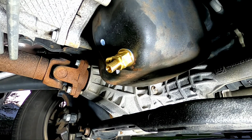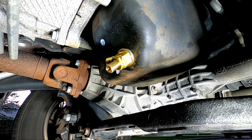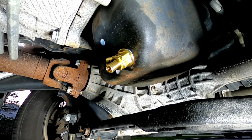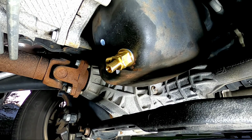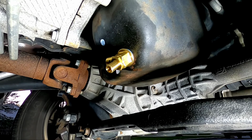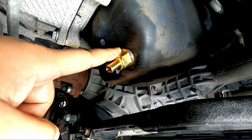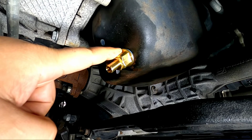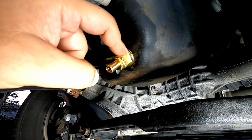Now, the best way to do it is what? Using a torque wrench. So any do-it-yourselfer out there, get yourself one. They're on Amazon. I'll put mine in the link in the description. They're cheap, guys. Definitely get one, because most things on your car have a torque spec. And most drain plugs on pans have torque specs, and most guys do not know that. So now you know the deal. Just to review, the torque spec on this is 18 foot-pounds for the F106. I'll make a separate video for the Subaru. And you do not torque from the front, you torque it from the body or the side.